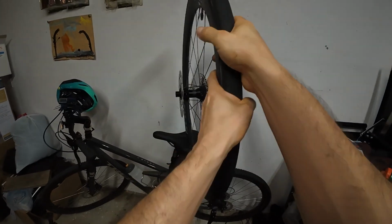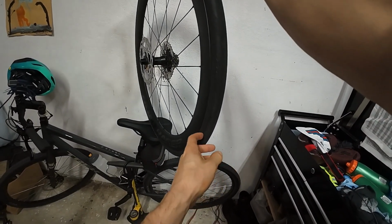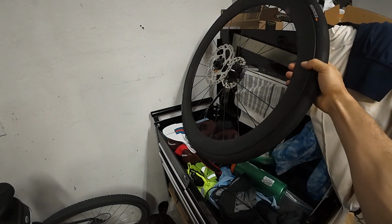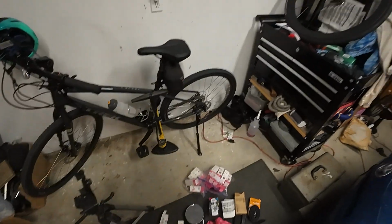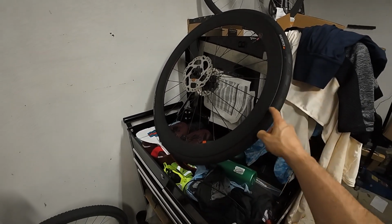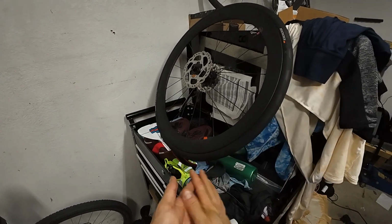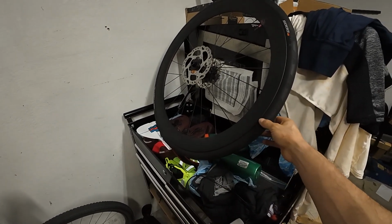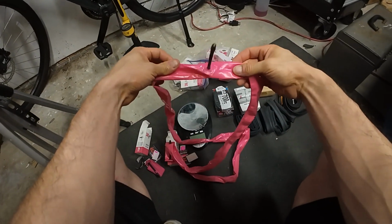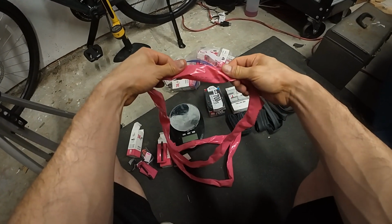I didn't really feel much rolling resistance change going from the butyl to the TPU, but on paper I know the measurements show that there's significantly less rolling resistance with the TPU tubes. And there is a definite difference in removing that mass around this wheel. They felt much easier to accelerate, even though it's a small difference compared to the mass of everything else. It's definitely noticeable. And I have not tried patching these. Obviously I haven't even gotten a flat, so I can't comment on that.